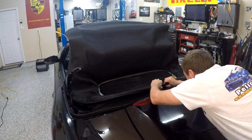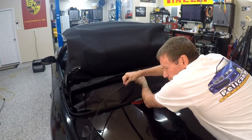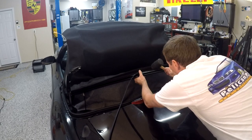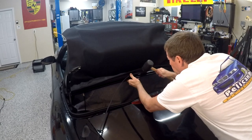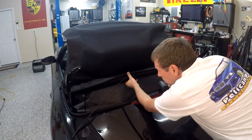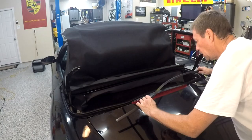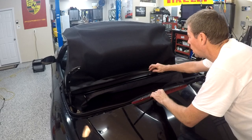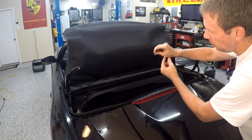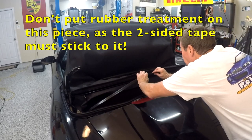With the plastic edge turned down in there, press the ceiling rib down and use a rubber hammer to tap it in there. Keep working your way to both edges, checking periodically to make sure nothing has popped out. The support rubber goes in next — it goes in the next slot down. This profile is short on one side and long on the other — it goes in the channel just like that. Mark the center line and press it down in place all the way around.